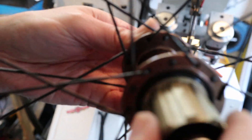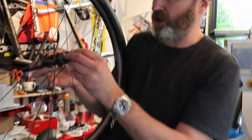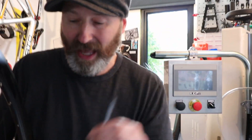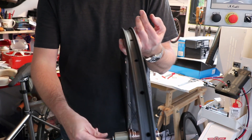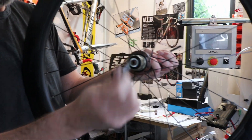Properly installed, there's only one more thing to do: secure the axle with the end cap. If you ordered a through axle, you'll find 17-millimeter flats on the ends of the axles, so you need two 17mm wrenches or spanners to do that up. With a QR axle you need two 5mm hex wrenches or Allen keys to finger-tighten your axle. There's no specific torque setting — you wind it until you feel resistance, and at the point of resistance you give it a little bit more. Basically when you can't rotate it anymore, that's it — that's locked.